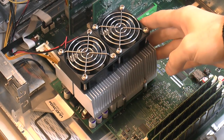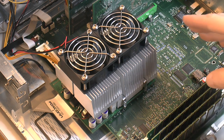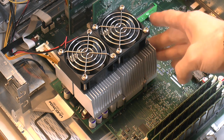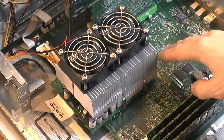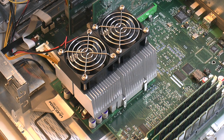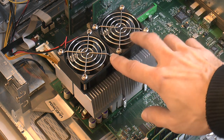And over here we have the PowerMac G4 CPU. It's an 867 megahertz CPU running at 800, and that's because it's a 133 megahertz bus version running on an earlier board with a max bus of 100 officially. So it's modified to a multiplier of 8, which is the highest I can make it run at. And it has two brand new fans.